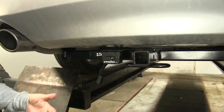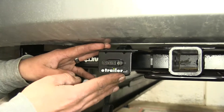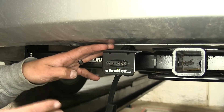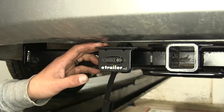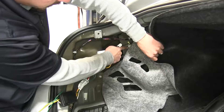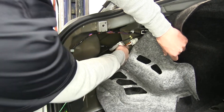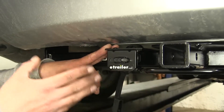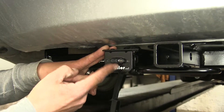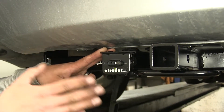The wiring is designed to stay on the inside of the car, and you would open the trunk and drop it down. Regardless of whether you put it on the outside or leave it inside, it's going to be a relatively simple installation. We're not going to have to worry about splicing into our factory wiring or cutting anything behind our taillights because it is just a simple T-Connector that connects in line with our taillights. Our converter box is powered directly by the battery, which puts less strain on our factory wiring, converts all the signals to a working signal for our trailer, and it's also fuse protected. Everything we need to get it installed is included in the kit.